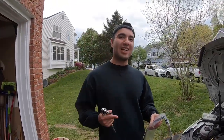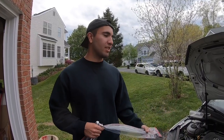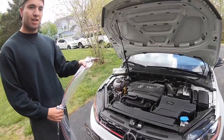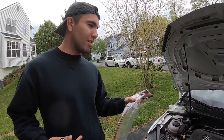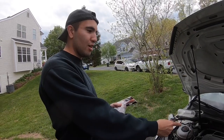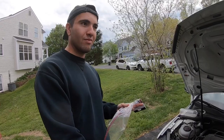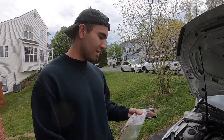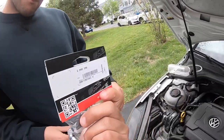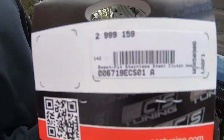What's going on YouTube, hope you guys are having a great day. Today we're going to be working on the MK7 — got the ECS stainless steel clutch line. The stock system has two delay valves: one swirl valve at the firewall, and the bleeder block has a little delay valve in it, so we gotta pop that out. The ECS line has a little clip — part number right here just in case y'all need it.